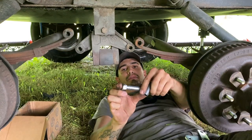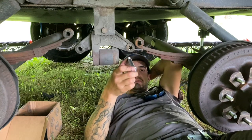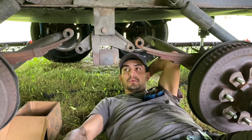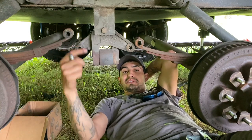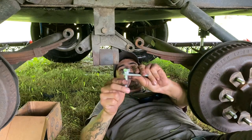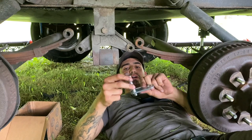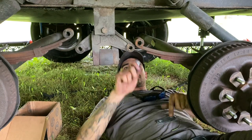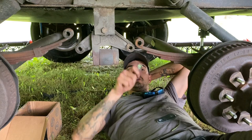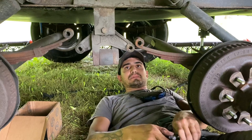On a new bolt, right up here at the neck, are a bunch of tiny teeth. Those teeth grip when you put it in. These old ones I just took out came out pretty easily, but the new one that I put in and took back out came out as one big piece because those teeth grab in and when the bolt gets wrenched down it gets pressed in and does not move. That's why you loosen the nut and not the bolt — on the other side I struggled for about an hour trying to loosen the bolt when I should have been loosening the nut and just wasted half the day. Now let's get these new ones in here.